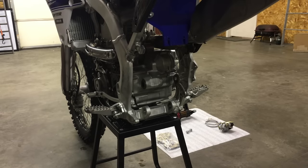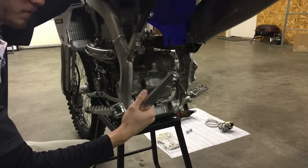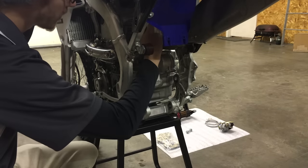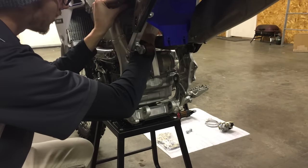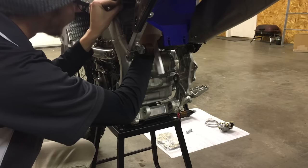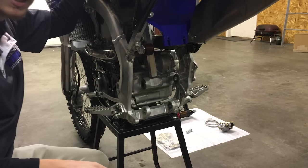So what I'm doing here is installing the shock strut. Take this upper end with the spacer in it, put that back into where your upper shock mounts, then use your existing shock bolt from the bike and push it through until it gets locked on and leave it sitting there.